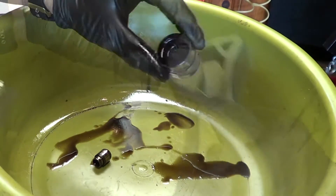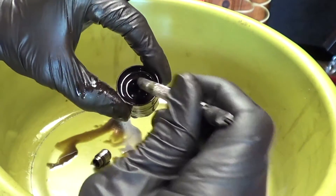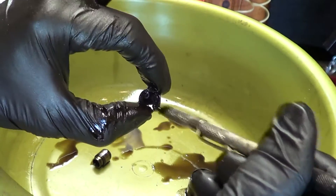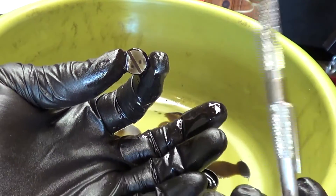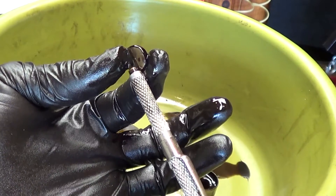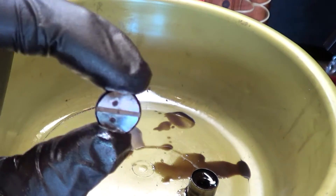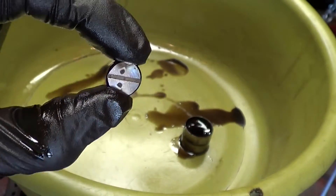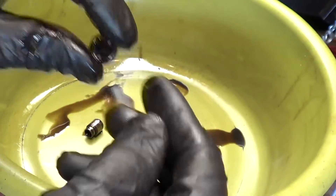There's our body. Down in here I took a magnet. This little coin here has two tiny holes in that slot — one there, one there. Now if I put that up to the light and look through it, see how there's light through there? Some of them when I took them apart, you couldn't see through it. That's what gets stopped up and causes these not to work.